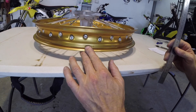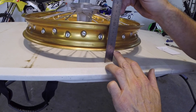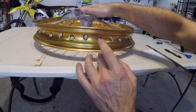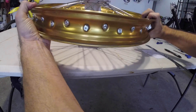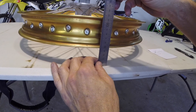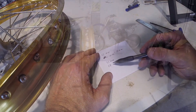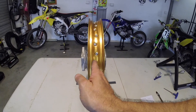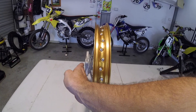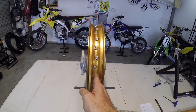This table's probably not 100% perfect, but with the hub laying down, I'm getting a measurement of 32 millimetres to the edge of the rim. When I spin the wheel around to the other side of the hub, there should be a 16 millimetre difference to compensate for the thickness of the hub on the other side. Measuring at 48 millimetres — the difference is 16 millimetres, and it is. So when you look dead set in the centre of the rim, this is a measurement from spoke to spoke. Because the hub is 16 millimetres wider on this side, I needed that measurement to be 16 millimetres greater than the measurement from the other side, so that it lines up to the centre of the hub. And it is.